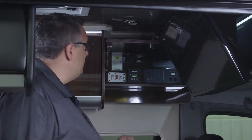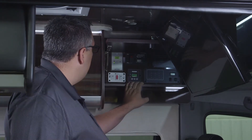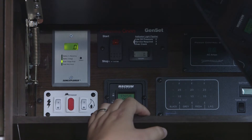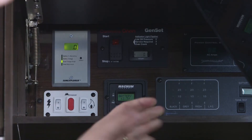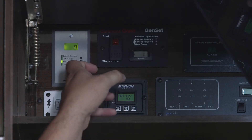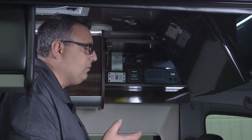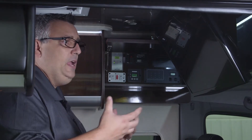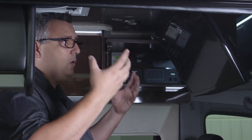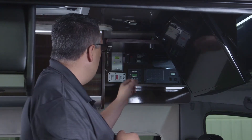The battery voltage is currently 12.2 to 12.3. The next reading is solar charge amps — if we're out in the sun and actually bringing in power, I would have an amp reading here. Our system has a 100-watt solar panel on the roof, so at peak with the sun in an upright position we could see over 5 amps of power coming into the unit.